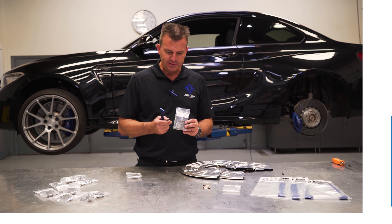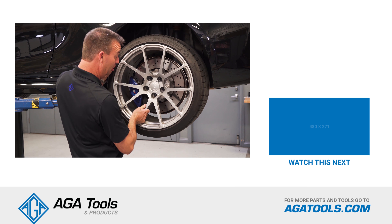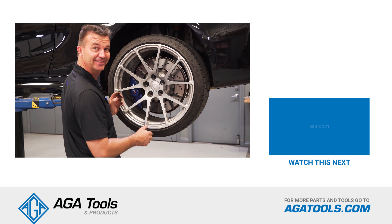To avoid all this nonsense with little rocks coming in here and creating all this noise and all these problems, here is the solution. The solution is the AGA backing plate screen. This backing plate screen is designed to click right into place in your existing backing plate and can be installed in just minutes with this simple tool. You take the backing plate screen and snap it on to the install tool. Once it's on the tool, you reach up into the backing plate area. Keep in mind that in the car, the suspension is right here and very tight, so very limited space. But this is very skinny and can go right in between the suspension and the backing plate. Once you're in front of the hole which is going to receive the screen, place the screen on top of the hole and firmly push in and the screen snaps into place. Now the screen stays in the backing plate and comes off the tool.